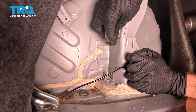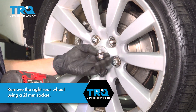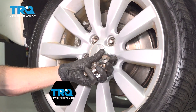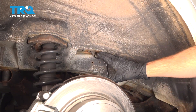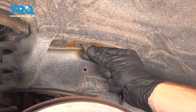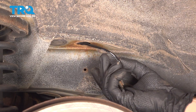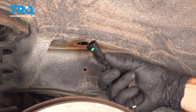A quick inspection of both sides for corrosion. Now that we have the wheel out of the way, we're looking deep inside the wheel well area, and this is where we can see our ABS wheel speed sensor wiring harness. We're going to be making our way downward, but first let's start right up along this area. You can see that we have a rubber protective plug. This is the seal that leads up into the body of the vehicle — you can see it from up inside the trunk. We'll just go ahead and pull down on this and remove that connector.